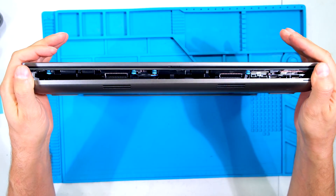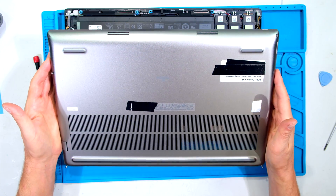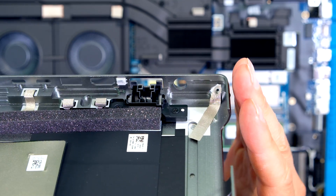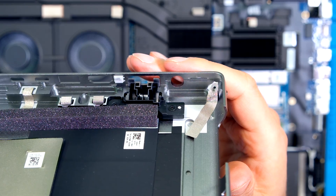Notice that the back is still around that bend, so I'm actually opening this like a scissors — lifting from the front and then going a little bit back to remove the back cover. It's very important to notice that the back cover, which is aluminium, leans inwards, and that is why when you open it you have to open it at a slight angle.